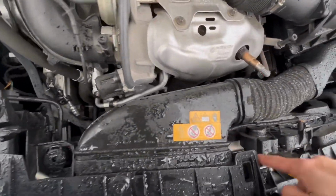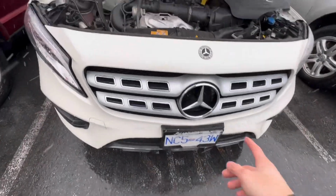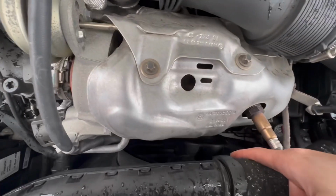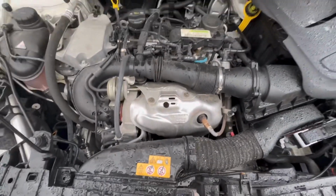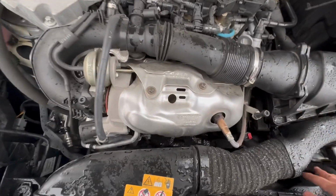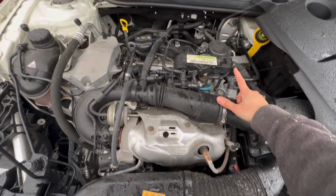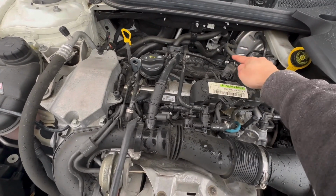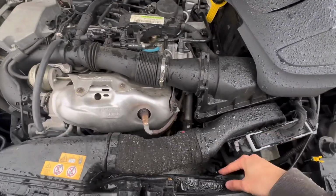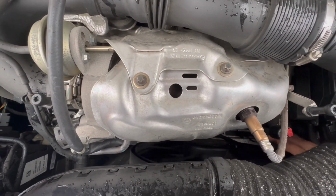The radiator has fins inside. The air from the front goes inside and helps the radiator cool down. And this fan is gonna work when the temperature is more than 100 or something. Who opens the fan? They have the coolant temperature sensor there. When the coolant temperature gets hot, it sends a signal to the PCM, and the PCM sends the signal to the fan, and the fan is gonna work and help the radiator cool down.